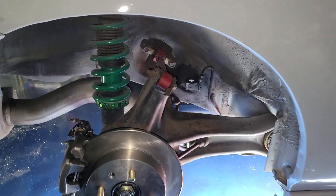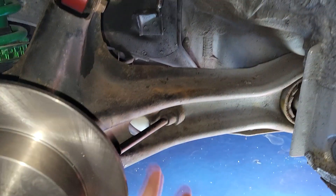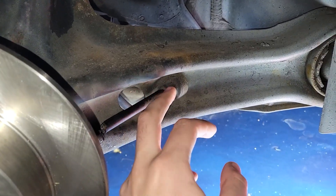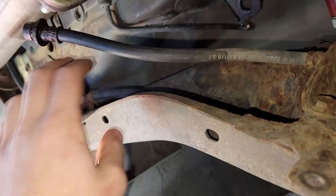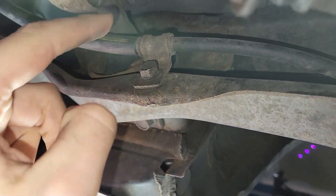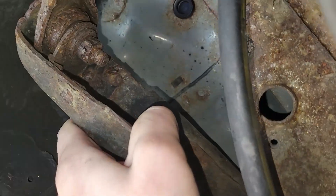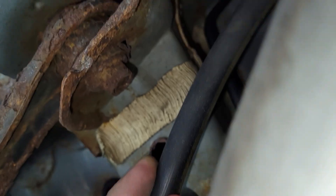The first step is going to be removing the old cables. We'll start on the passenger side. Here is where the old e-brake was, connected to the back of the drum brake assembly. We cut that so we don't have to worry about it anymore. The e-brake cable feeds through the trailing arm here. Here's where it goes through the trailing arm and it's connected with one bracket — that bolt looks like it'll be pretty easy to take out. The cable also goes kind of underneath the exhaust.